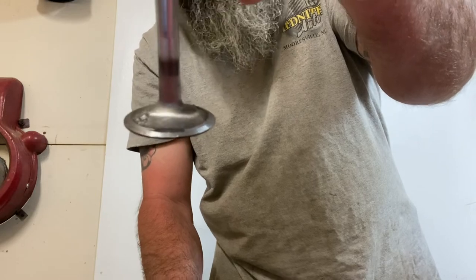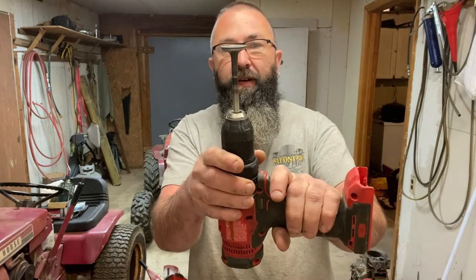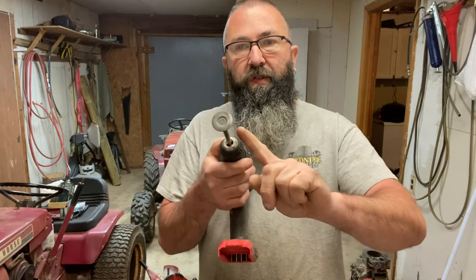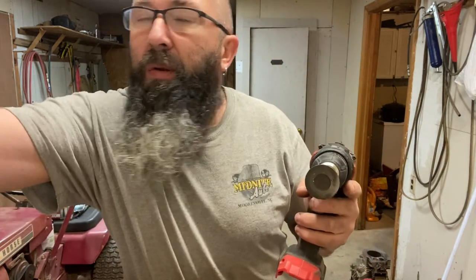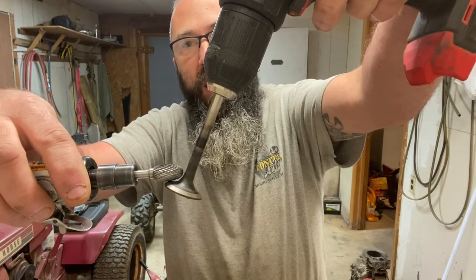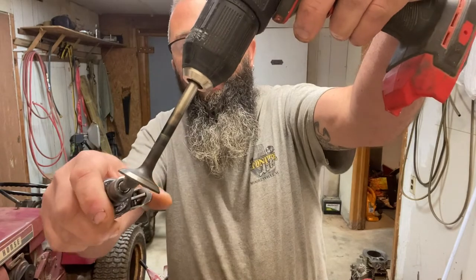Very hard to see on the mower stuff, and that's why I recommend looking at some other YouTube videos. Let's go over this valve job and back cut stuff — this is something you can do at home. It's tedious and you need to be very careful. If you have a drill press, great — if not you can do it with a cordless drill but you're going to have to be damn careful. Chuck your valve in there and take either a file — something very hard with a nice sharp edge. You don't want sandpaper because you're going to wind up with a radius. You can even use your porting tool with a straight bit and very carefully spin your drill and make a little back cut right there. You're trying to split the difference between the seat angle and the angle of the valve — just knock that edge off, don't go nuts with it, and don't get your contact area too thin.